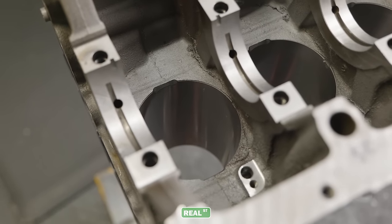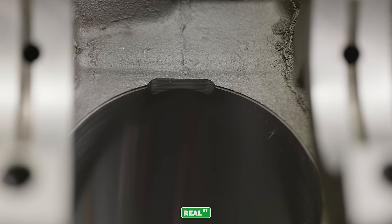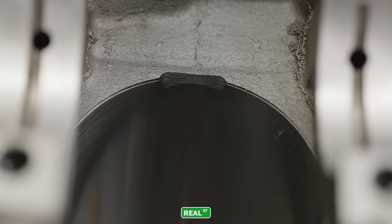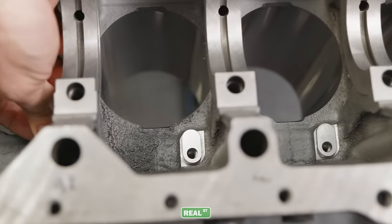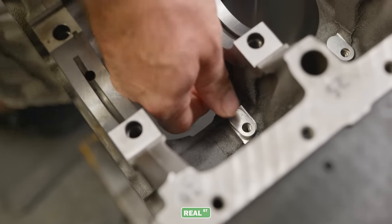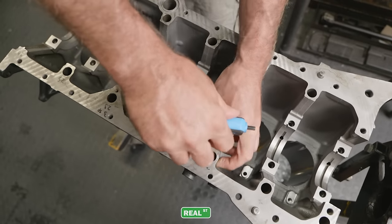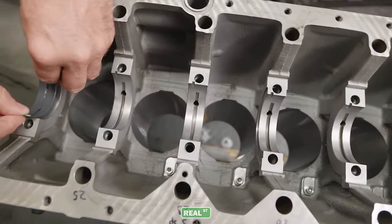The bottom of the cylinders has been notched to clear the connecting rods. Whenever you increase stroke on an engine or you're using a larger than stock connecting rod, it's always good to check connecting rod to block clearance. This engine is going to be using a stock style oil pump, so I elected to use a piston squirter block-off because I'd rather have the oil pressure available for the bearings. Using an alcohol-based fuel like ethanol or methanol in a drag race environment, I'm less concerned about the piston cooling jets than I am the oil pressure.